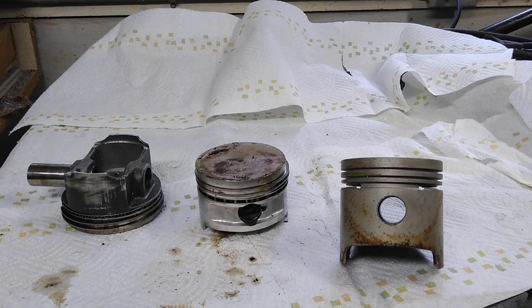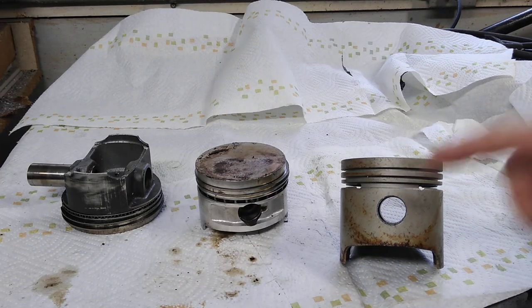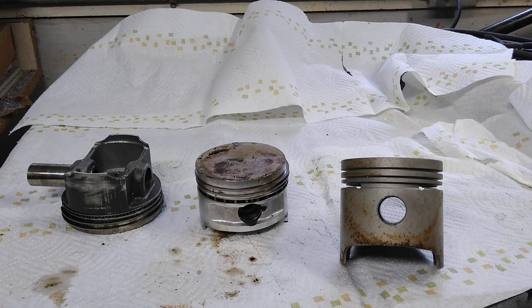This would be considered a stroke A. So when you see a set of 94s for sale and it says '94 A's,' that means the pin height will work with your stock 69mm stroke crank and not require any shims or other work. It should bolt together pretty much like a stock motor. You can use these in mild stroke applications.